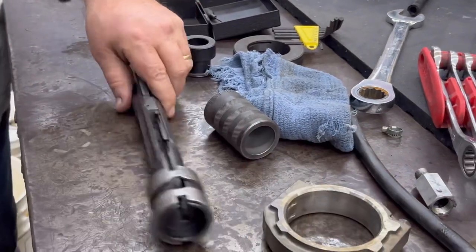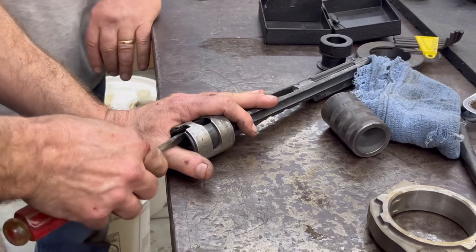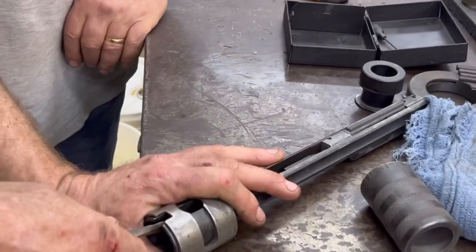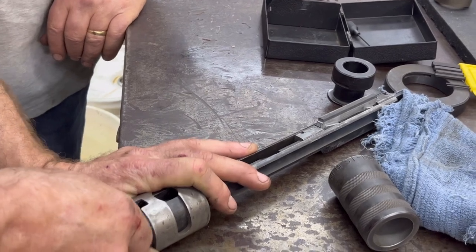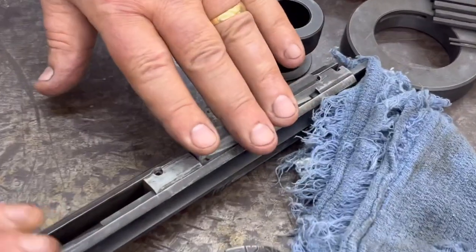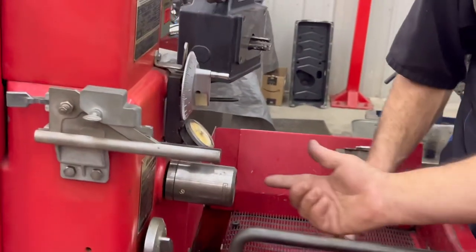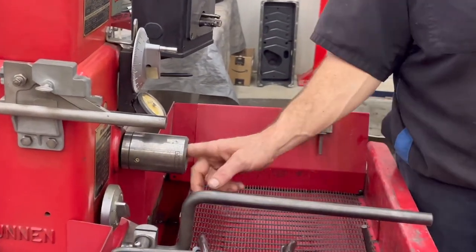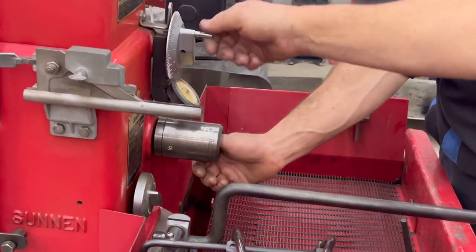Push that wedge in with your screwdriver and see what happens to your stone. Yeah, buddy. Oh, it goes a long ways too. You've got an eighth inch travel. And that is hooked to that feed rod that's in there. Well, but adjustable by that? That's only adjusting the spring. This is moving it in and out.